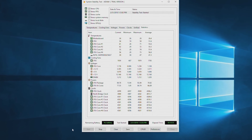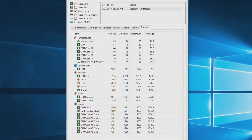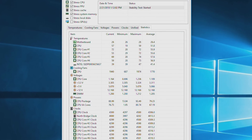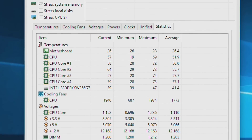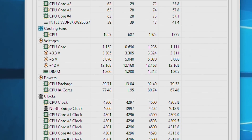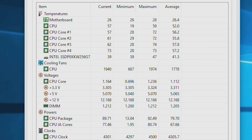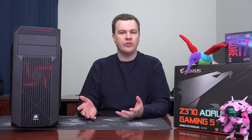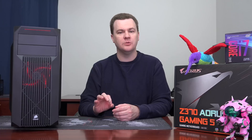That's what you're looking at right now. I ran this for over 30 minutes to make sure the CPU was fully warm, everything was fully spun up, and as you can see, the averages are absolutely trivial — in the 50s. Yes, it temporarily spiked higher, sometimes into the 70s, but seriously, you are looking at temps so far below this chip's max operating temperatures. You will never have a temperature issue on the CPU. To be completely fair, a 120 millimeter liquid cooler is unnecessary for this — a Hyper 212 Evo or something similar in the $20 to $30 price range would be enough. But the liquid cooler looks nice and removes any temp issues. For what it's worth, I tested this system in a 72 degree Fahrenheit room.